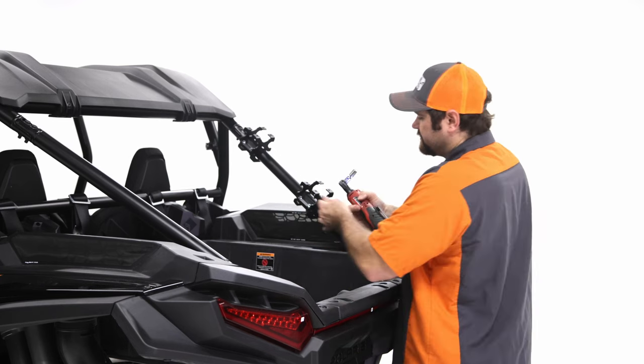For this bracket, you're gonna see that it's kind of got these 2 bends here. You're gonna wanna face that outside, and this rubber bumper is gonna actually go right inside of this slot, just like that. So you want it facing that way. And you're gonna take your 1/4 inch hardware and put it in the top. And then you're gonna put the other one in the bottom.